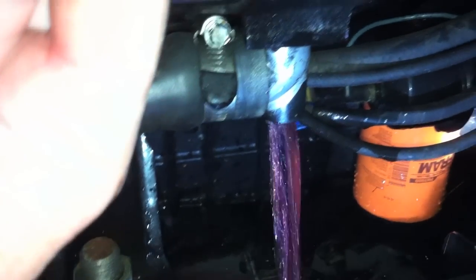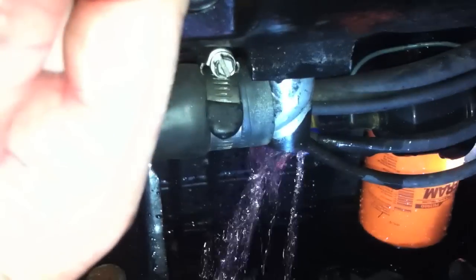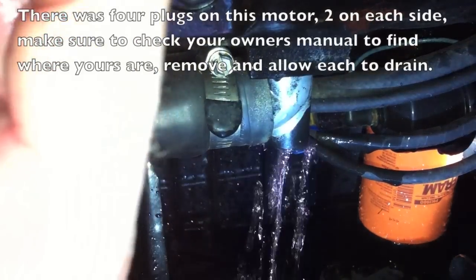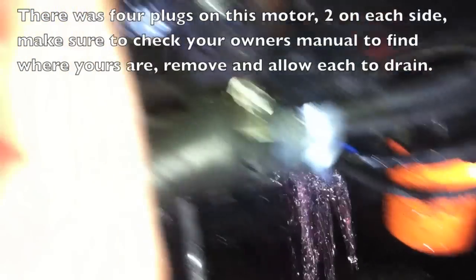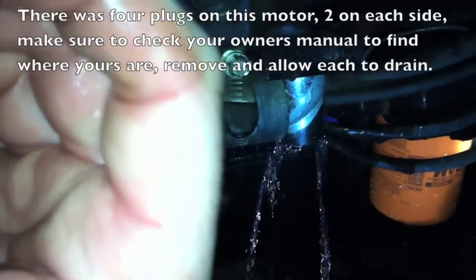All right, we've sprayed all the pistons, we've turned it over, we put it all back together now. Make sure you put it all back. Okay, there's a couple plugs you want to pull, and we're going to drain all the antifreeze out as well. You don't need to, but it doesn't hurt to get all the fluid out of here now, where we can. There's one here, another one just there. Take a look, it looks like this. It's a butterfly plug, twist it off by hand. There's one there, and there's another one further under this motor.